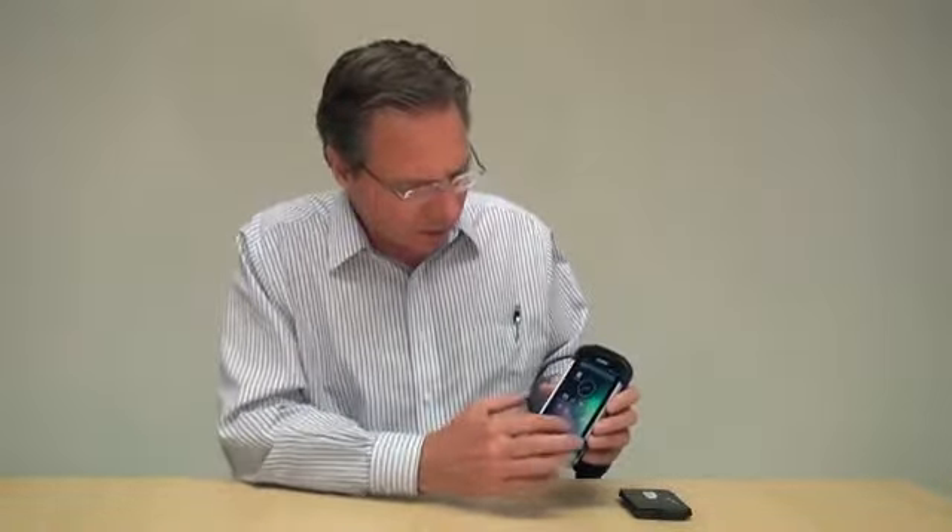I said I would show you how to switch SIM slots. When this device ships out of the factory, the default SIM is nano SIM one, and there's basically no way to go in and change that without first provisioning or staging the device with the WAN_UI.config file. You basically just load that file to the internal SD card or the external SD card at the root directory. Once it's installed, that'll enable a UI that will then be shown to you — and this is the UI I'm going to show you right now.